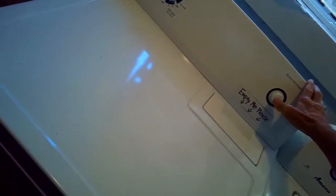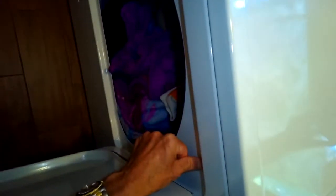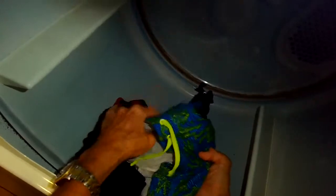When I opened it up I found a lot of things causing it not to go. One is it was overloaded — it had a bunch of blankets and super heavy stuff. I'm pressing on the lid switch and then pressing the start button, and I can see it move a little bit like it's trying to go. The motor seems to be either overloaded or really dirty. I also found an article of clothing caught between the tumbler and the back of the dryer, which creates more friction — kind of like a brake — that can slow down the tumbler and overload the motor. Now that I got all the clothes out it does start, but it still shuts down after a limited amount of time, pointing toward a motor that's overheating.